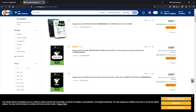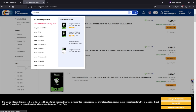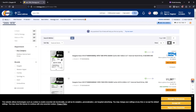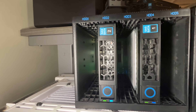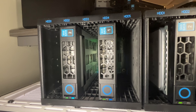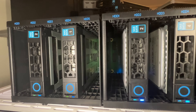There is talk of a 50 terabyte version in the next couple of years. Reliability-wise it's a little early to know definitively, but the drive comes with the same warranty and MTBF figures as the other Exos drives. These drives have been deployed to hyperscalers for at least a couple of years, and Seagate says they've exceeded reliability expectations. I can't thoroughly test reliability myself, but I put 1.3 petabytes of data through this disk during testing and it hasn't skipped a beat — that's already over two years of the stated maximum annual workload of 550 TB per year.